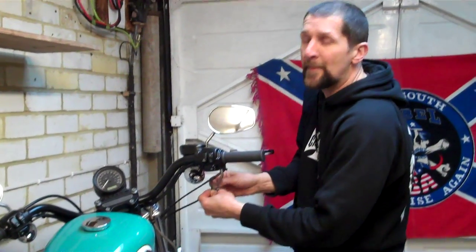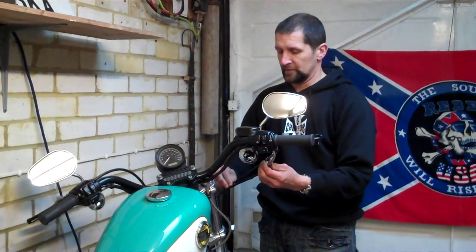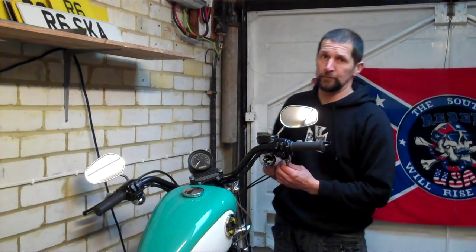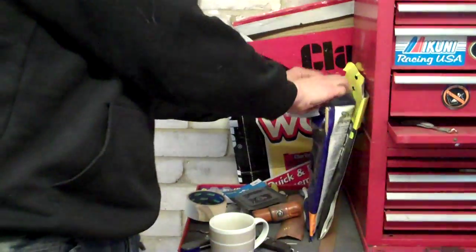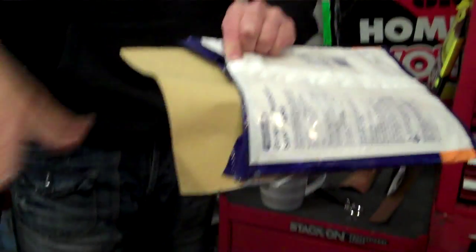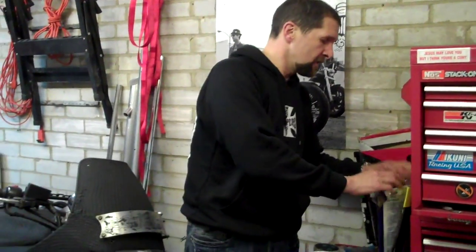That's the first half. The other thing you asked was about painting. I've done a lot of painting but I'm by no means a painter — there are loads of guys who do painting ten times better than me. You asked about painting your horn cover. There's stainless steel underneath and that black coating on there is a powder coat — it's quite good but it's really hard. I wouldn't waste money getting it powder coated again. Just get some good old fashioned coarse sandpaper and beat all that coating off. Scuff all that black stuff off, and the surface of the metal will be really gritty and keyed up. Once that surface is really rough, put some nice etch primer over the top with a can, then rub that back and bodywork it like normal — it's as simple as that.